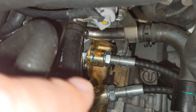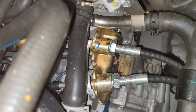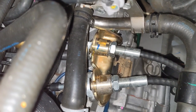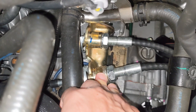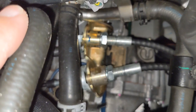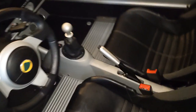I used some Loctite on the bolt just to make sure it wouldn't back out with use, because if this is going to work I wanted it to be semi-permanent. And lo and behold, it solved the problem — now there is no buzzing in the car. The problem apparently was that vibration was making it through these very stiff cable sheaths for the transmission cables, vibrating at just the right frequency on the console itself. It wasn't in the shifter but the vibration was affecting the entire console, and that would make noise in the shifter because the shift lever itself is the thing that can move around a little bit.